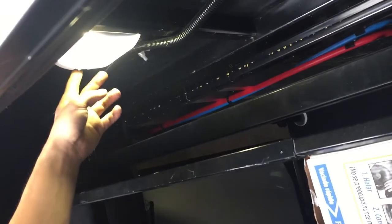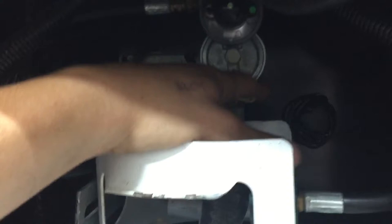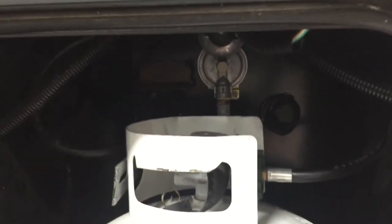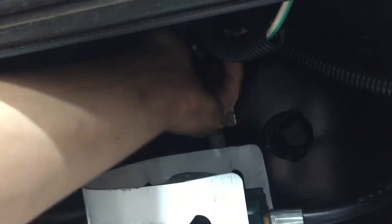Right up top here there's just a little light. We have another non-lockable compartment here — open that up and there's your propane tank. This is where you have your changeover. You can see up top that little green dot is letting you know which tank you're drawing off of. Follow that hose over to this tank, open it up and draw from this one. Now if your propane appliances stop working, that tank's gone dead — just take that changeover, flip it to the other side, and that's that.